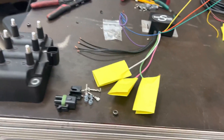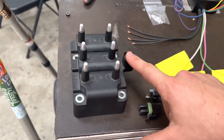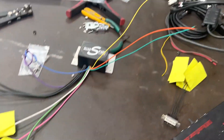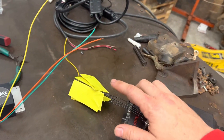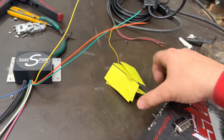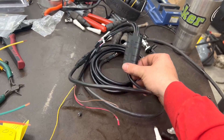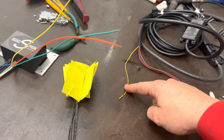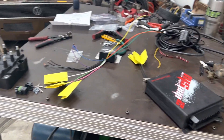I went online and found out all my pins. I've got all of my outputs for the quad spark which will get pinned into this connector, plug into here, and then these will go to my spark plugs. But those need to be driven by three wires which will be connected through a harness into three wires here — the order of those is paramount and I sticky-noted them so I wouldn't forget. This is also the plug where my wideband oxygen sensor goes, which is an Innovate Wideband Controller and Sensor — that input will mesh into this so the computer can run wideband data and have a better picture of the AFR.